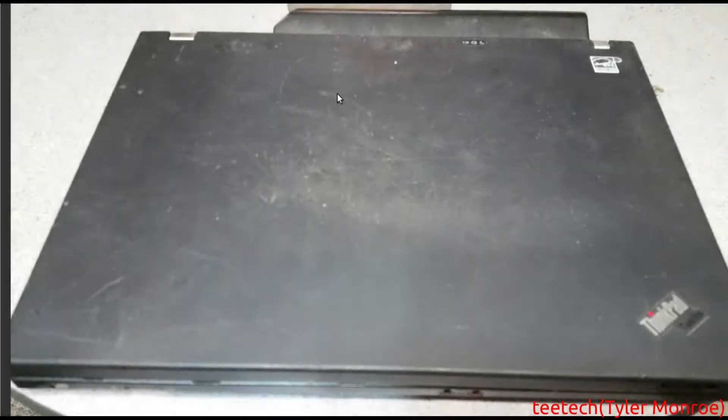Hello and welcome to this episode of TTAC. On today's episode, we're going to talk about how I replaced the motherboard on my ThinkPad T61. What happens with these models is the GPU is a ball grid array, BGA style, and it warms up and then cools down so much that the solder balls in there actually crack in small ways, stopping the GPU from functioning and messing up the image.